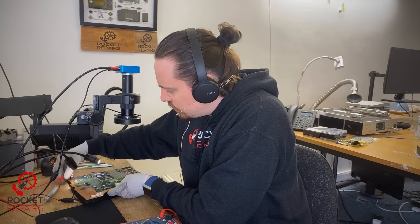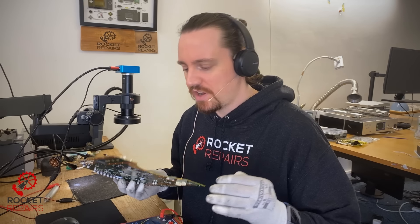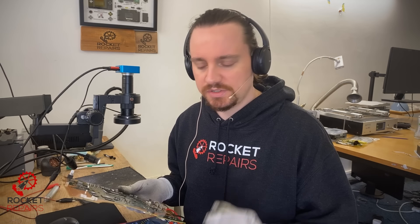Today we have job number 12217 and it's a faulty PlayStation 5. When you put the power in and press the power button, you get maybe one beep in about 10 seconds, which is strange. On PS5s I've fixed before, it's either a continuous beep every one to two seconds with no LED, or an LED and a beep, or flat out no beep and no LED.